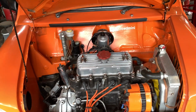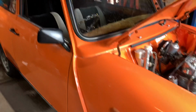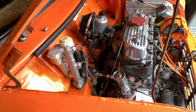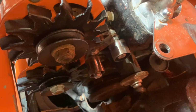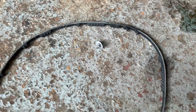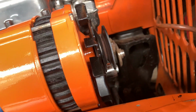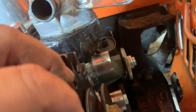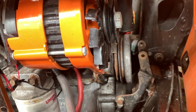What we'll do first is fix the fuel leak. Had to pump the tyre up as well, because that was completely flat. It's a proper barn find now, look. Right, let's change this bit of pipe and then get on to the real stuff. Radiator's out, fan off. And there's that end of the engine. Now, that's the reason I'm changing it over to a multi-rib belt. That's been on there, I would hazard a guess, at less than 50 miles. So, got to get all these pulleys changed over for the different ones, and fingers crossed that'll solve my problems. Who knows? Let's hope so.